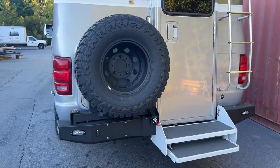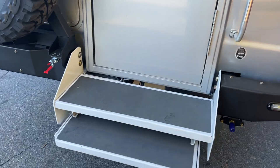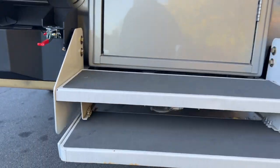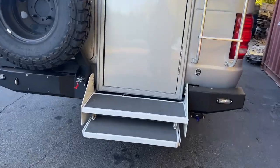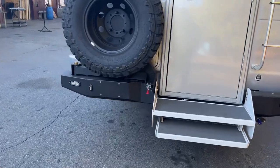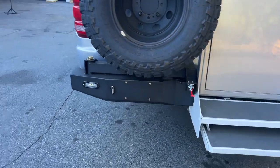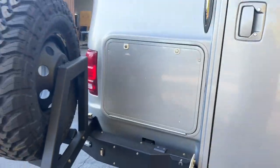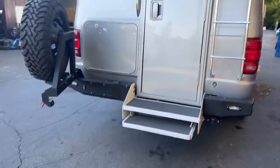What appears to be a stock bumper out back is not. We started looking at the design for a replacement bumper, and it's really hard because of the way the frame is done, the way the step is set up, and the way the hitch is set up. There's actually a trailer hitch hidden right there, because this is the only access to the camper, so keeping the step functional was key. We played with some of our existing bumper parts, cut them up and modified them to work with this Chinook. We've got the driver's side swing-out that works just like our regular bumper.